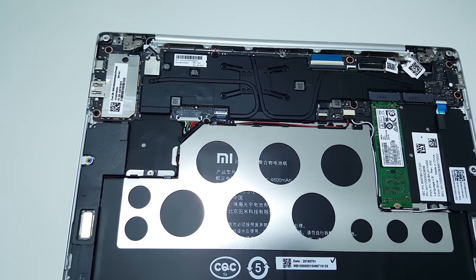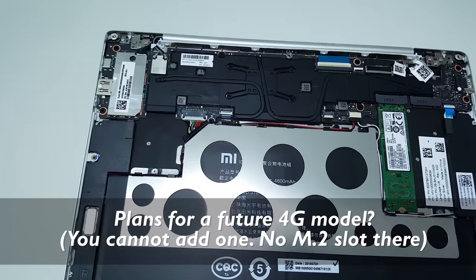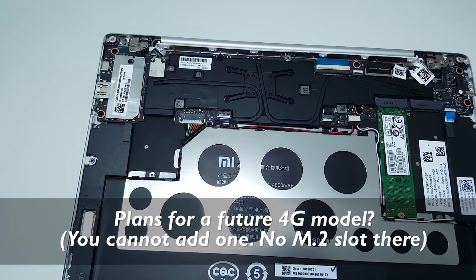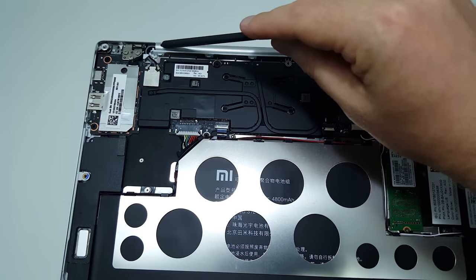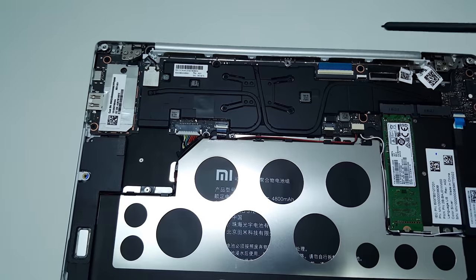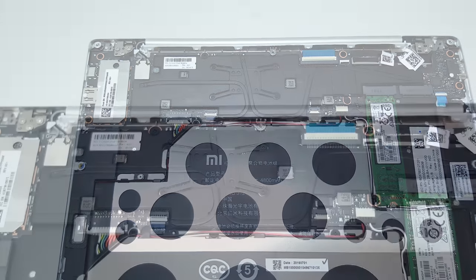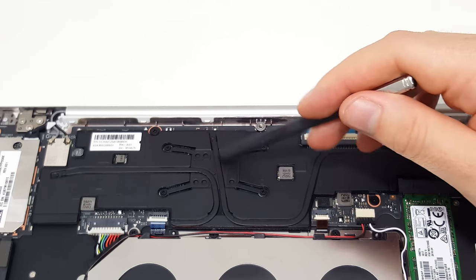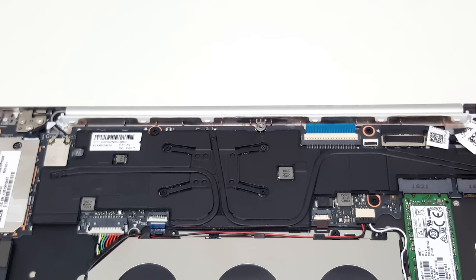You can see they do have plans to support LTE — 4G modem support — right here. You can insert an M.2 2260 modem in there. There's our Intel wireless chipset and the antennas, which connect up to the plastic backing — that's why they have plastic along the top. The internals look very nice, and this must be the reason it doesn't go over about 70 degrees during gaming and benchmarking: they have heat pipes running from one side all the way along to the other.